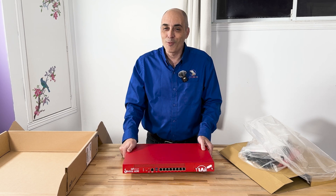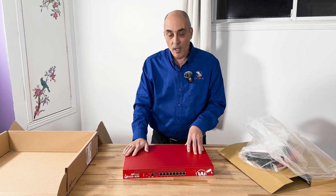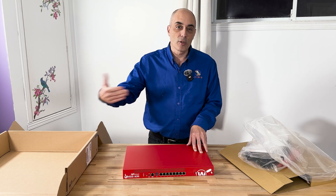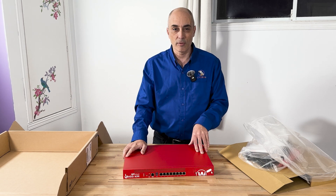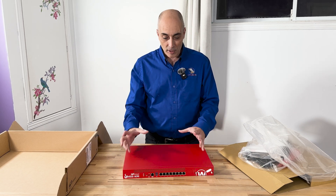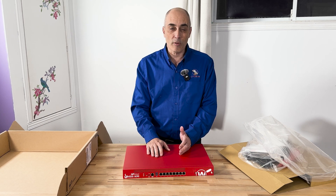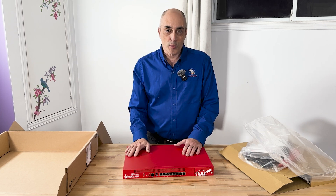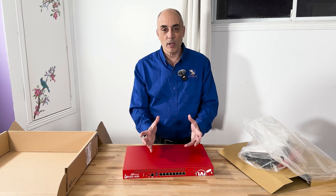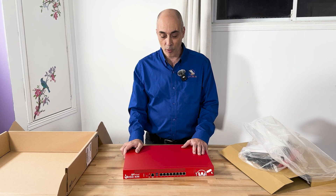This model will allow 250 mobile VPN connections. Of course if you've got a lot of offices doing WatchGuard-to-WatchGuard site-to-site VPN, that same limit applies. If you go down to the M290, it goes from 250 to around 175 or 150 - I'll write it in the description below. As you go further down to the smaller tabletop-size WatchGuards, those are really meant more for home users or very small branch offices.